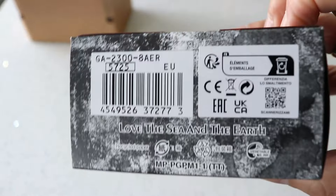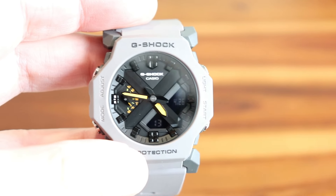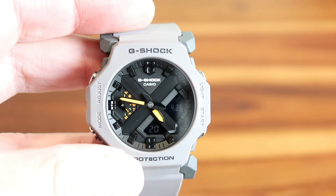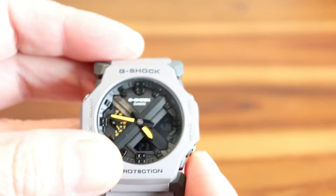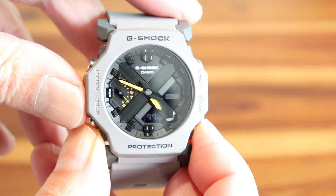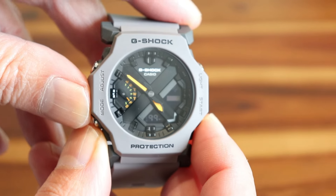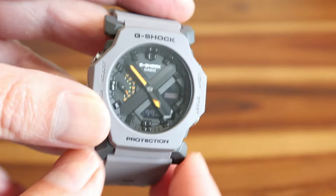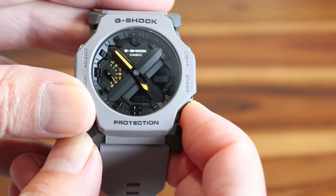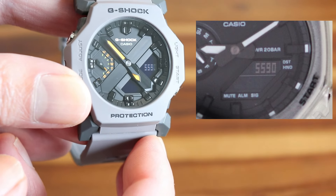It takes a little bit away from the experience of owning a G-Shock. Let's take a look at the diagnostic screens of the GA-2300 — you can also use this feature to legit check your G-Shock. To go into them, hold down the adjust, mode, and start buttons from the home screen. This will activate all the pixels in the LCD panels and will also make the minute hand start ticking every second. You can continue to scroll through the other diagnostic screens and exit with the start button. This screen shows the firmware version used inside the module, which is exactly the same as that in the GA-2100.